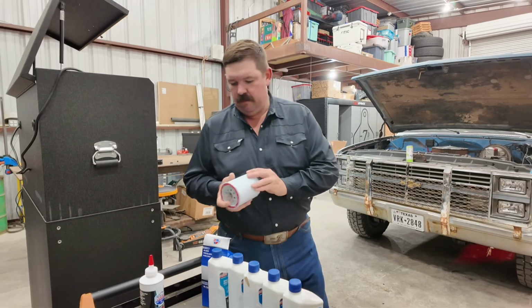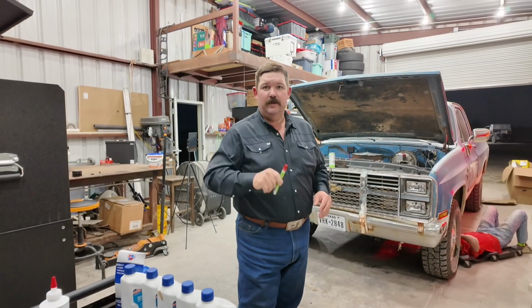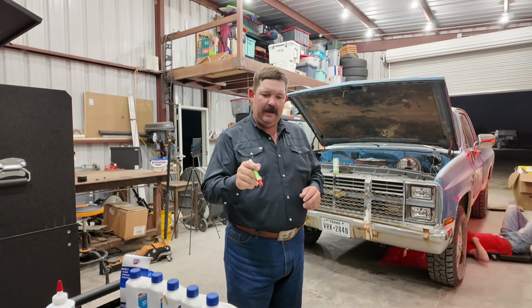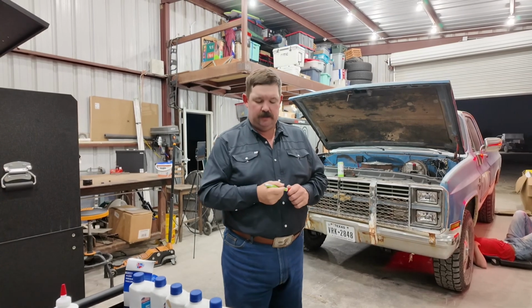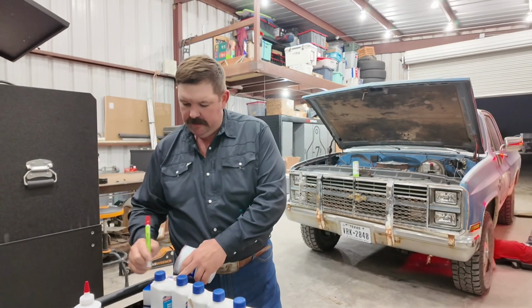I didn't, no. So the other thing I'm going to do, a little tip we picked up from Nathan the other day, the Kirby Smith mechanic who came out and did our first service on our track loader, is we're going to write the date and the miles on this oil filter so that we know when that was done. Oh, that's a good idea. What is today? Today is the 8th.